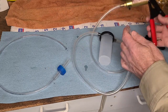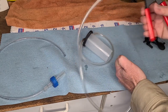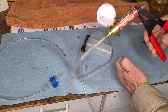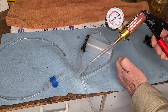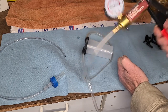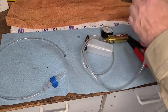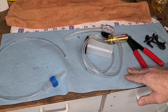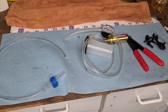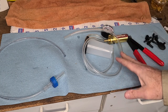So basically this is just a little hand pump. If you pump a bit, you can see it can draw a vacuum — there's five pounds of vacuum right there. It's not that hard to get. All we're really trying to achieve here is a difference in atmospheric pressure. Atmospheric pressure is like 14 pounds and it will push the fluid through — you want to just evacuate all the air.